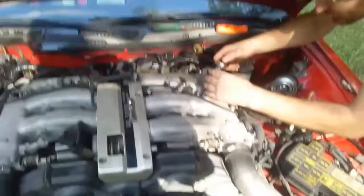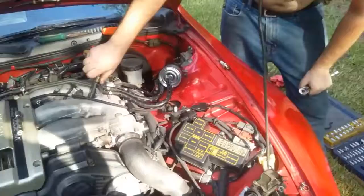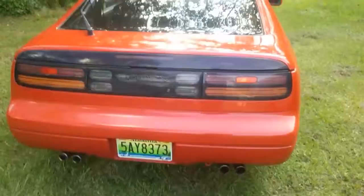Right now we got spark plugs going back in, got the booster back up, popping the coil packs in, hooking everything back up. The computer system should be reset already. I'm gonna try and do something with the TPS — not sure if we'll be able to today. We also need to check the driveshaft; I keep hearing a clunking from the rear end, pretty bad, feels like it's right under my seat.